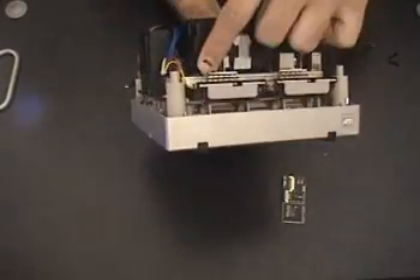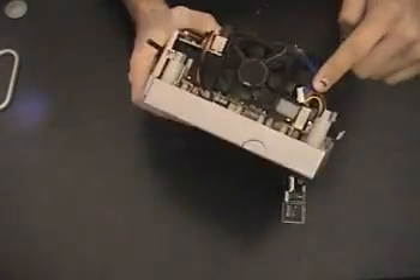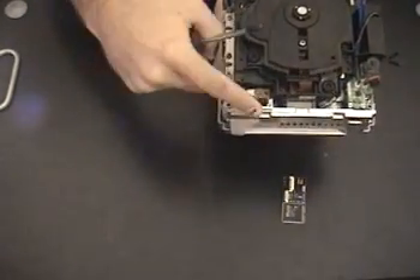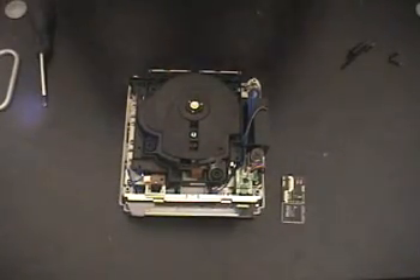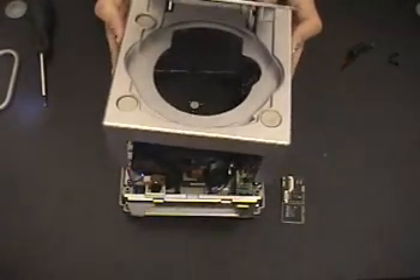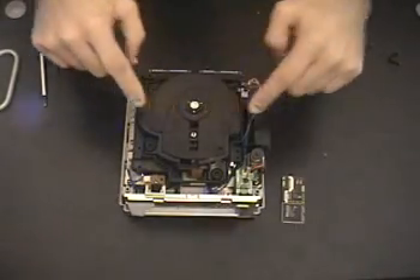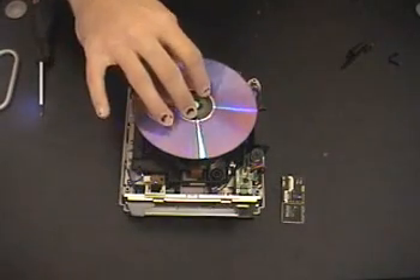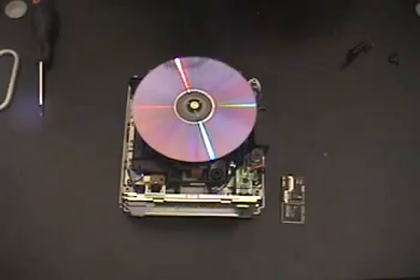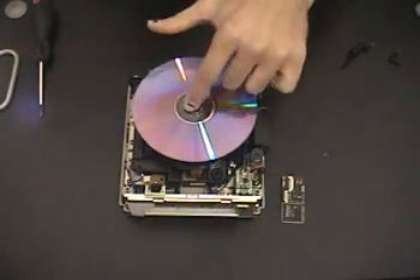When you install the chip, there's a small piece of the shielding that's supposed to be bent upwards — I just broke it off. These wires actually interface into the GameCube's system bus, and these wires over here lead all the way around to the lid sensor switch, so you can access the chip settings. If you don't have a custom GameCube case, this alternate case supports full-size discs. Original GameCube discs are smaller, but original backups or DVD-ROMs are full size and will not fit in a standard GameCube case. You can cut out a standard case, but that destroys resale value and you lose the eject button.